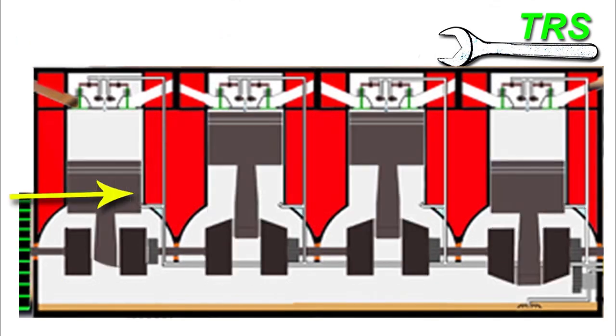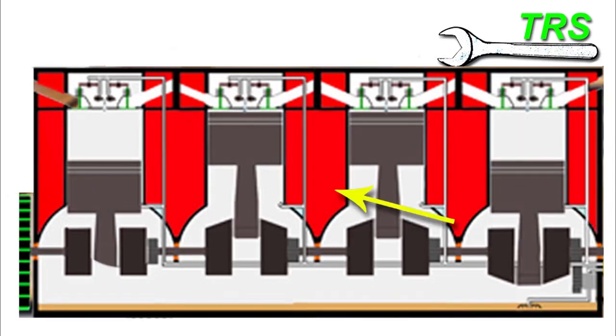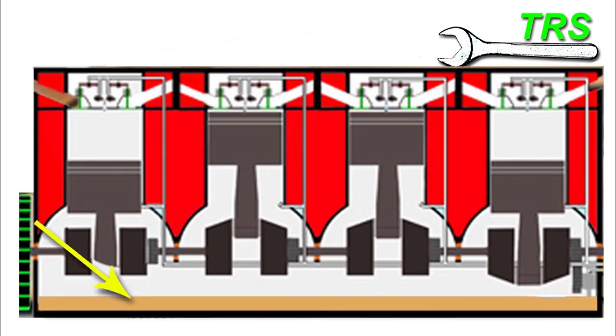Another thing to consider is that now the engine's stopped, a lot of that oil is still trapped between all of that piping network and some of those engine components. So that means that if some of that oil is still trapped up above, it's not going to give a true reading down below in the sump — it's going to show that there's less oil in the engine than what actually is. So now we've got the engine stopped and it's on a flat surface, I personally recommend waiting around 10 to 15 minutes for that oil to drop back down to the bottom of the sump.